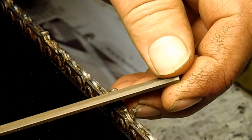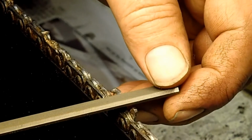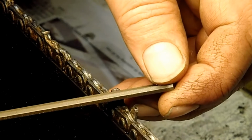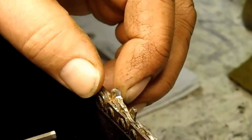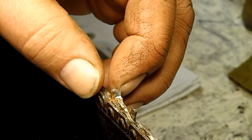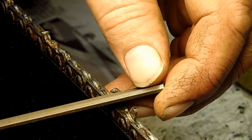If you change your top cutter angle, your angle perpendicular to the saw, then you have a shorter face on this top cutter than you will have with it at more of an angle. But you wind up with a blunter angle on the side cutter, so it's not going to cut as efficiently. So that's the compromise there.